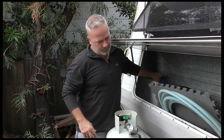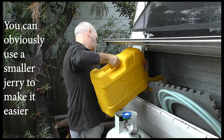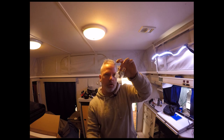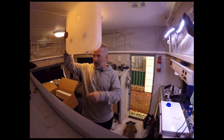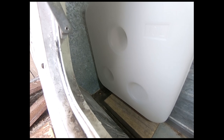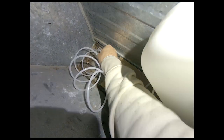This is just up in the corner where we've gone up through a drain hole into the boot, and here is our fuel tank at the front. The fuel tank itself is easily accessible — I can take the top off and fill it up just using a standard jerry can with a nozzle on it. That's the reason I went in this corner, obviously to minimise the space loss in the boot as well. This one is plastic — it's the standard one that comes with the unit — and I was concerned about putting it on the outside and having it sun-affected. We're in Australia and plastic things don't take too kindly to the sun outside. So that was going to age it a lot quicker than having it in the front of the boot like this. I've put a piece of timber under it just to support the weight of that 10 litres of fuel bouncing around while we're driving — the three screws literally just need to hold it in place.